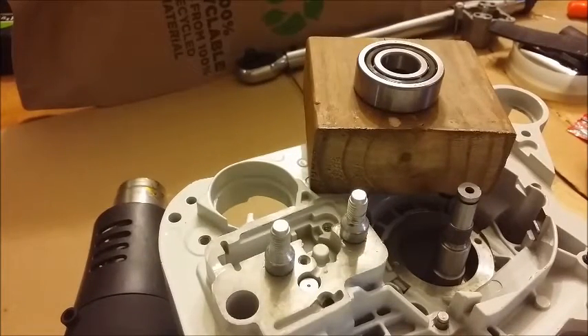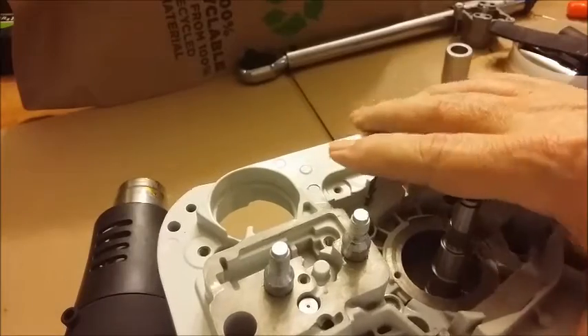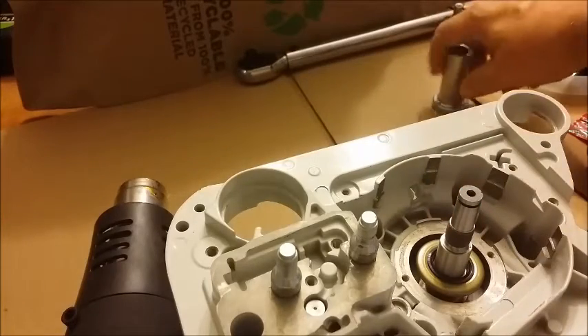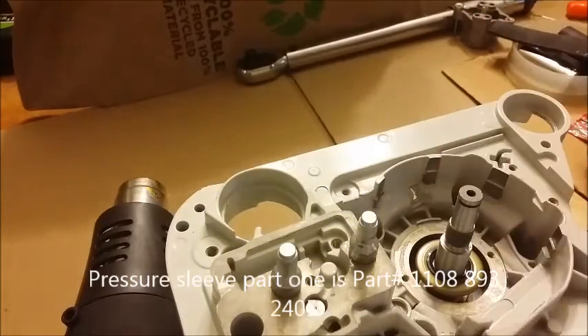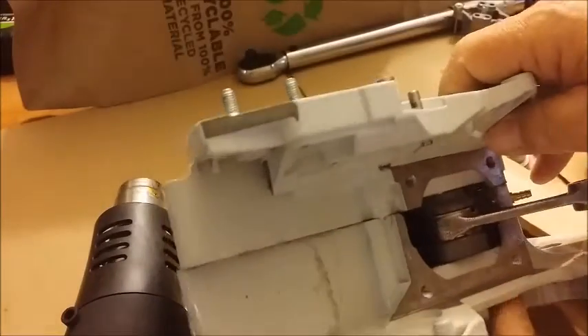We can pretend here a moment. If your bearing was in there, it would be flush. Then you take your seal — and this little ditty is the pressure sleeve — and you tap it into place. This is set so that it presses it to the correct depth, and that constitutes putting the case together.